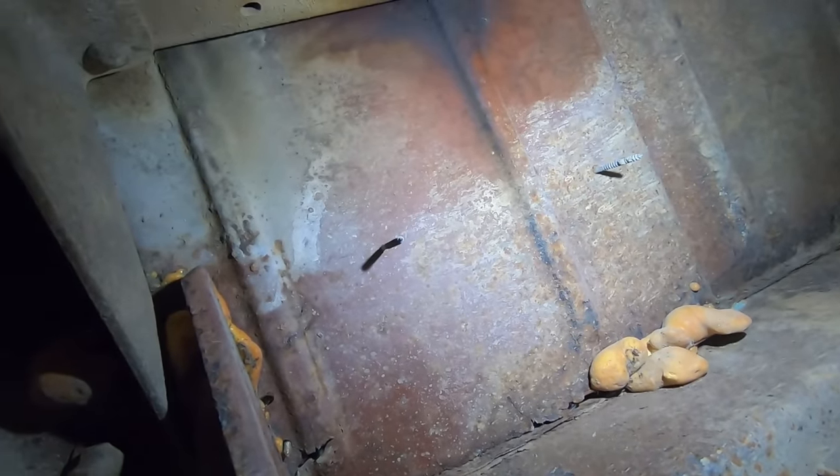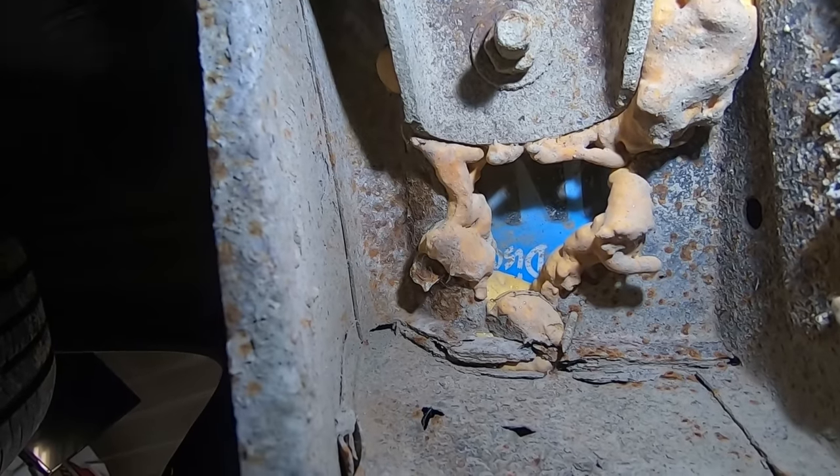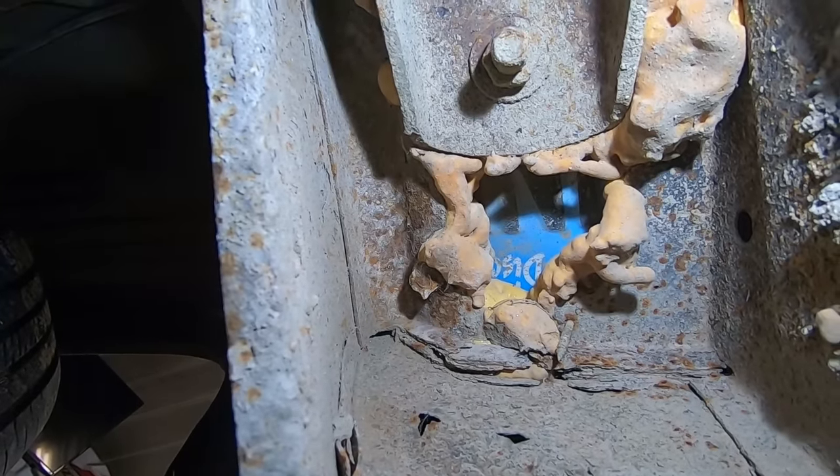Oh, I forgot just how good underneath this thing is. Whole lot of expanding foam. Some wood screws that are way too long, and they're not really doing anything because the threads aren't into the metal. They're way past it. I should probably put a new fuel hose back here. Remind me to do that, because that thing looks pretty soggy. And then, oh, yep, there's the license plate patch panel up there. Nothing but the finest.